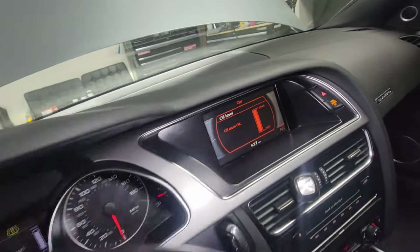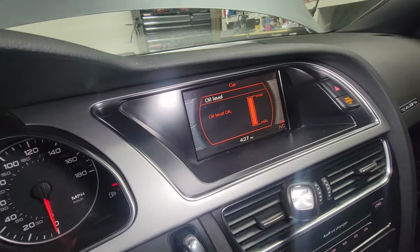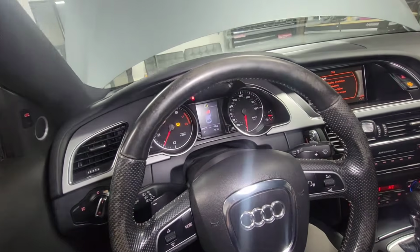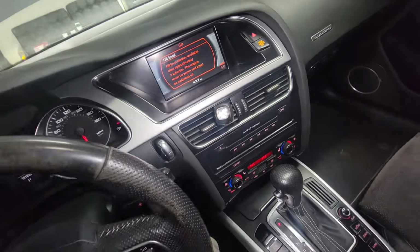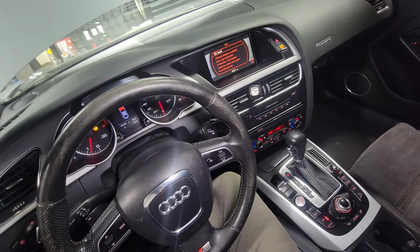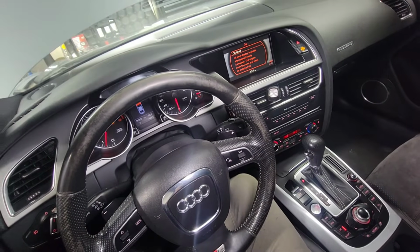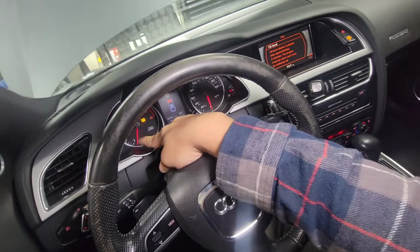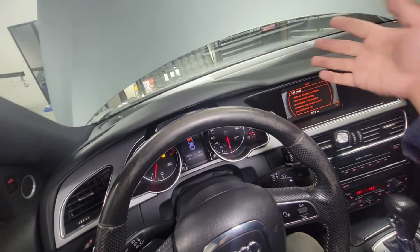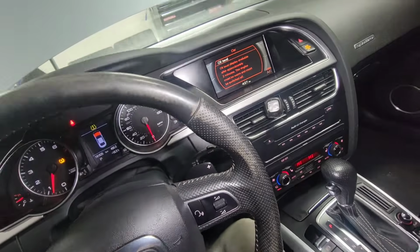All right, just want to double check the oil level here. You can see it looks good, looks okay. All right, so that's it, guys. That's how you bleed the air bubbles out of the 3.2 or 3-liter engine. This is non-supercharged. Pretty quick, nothing crazy about it. Just do the cycle of holding the RPM at 2000 for like 3 minutes, and then 2 minutes, and then you check for air bubbles out of that heater core line. Do it twice. That's it.